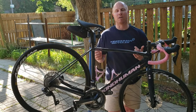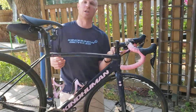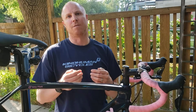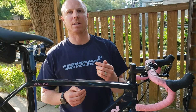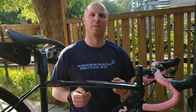To change the setting on your Di2 system, you just press the junction box, double click, and it'll cycle through manual, full synchro shift, and semi-synchro shift. Your semi-synchro shift is when there are three lights flashing after you do the double press.